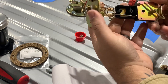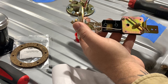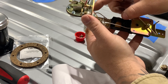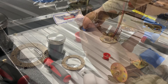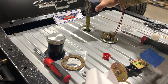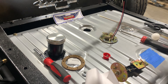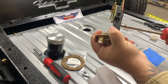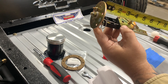To determine how high you want to mount this up, they want you to measure the tank again — it might be a little bit different because the tank's angled on the bottom. We're going to take a measurement from that part of the tank where the sender sits, add one-eighth again to compensate for our gasket, then take that measurement and divide it in half. Then we measure from there to the center of where the rheostat screw is. It's actually a bit shallower here — we're at six and three-quarters — because this area is recessed about three-quarters of an inch. So we should have just over three and three-eighths, which we do by one-sixteenth — exactly what we need.